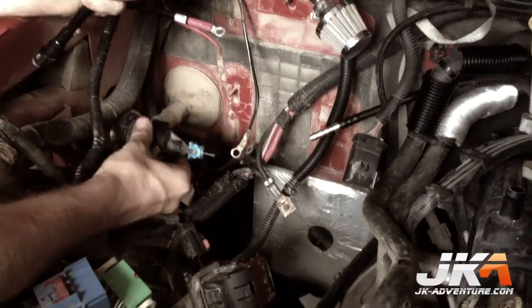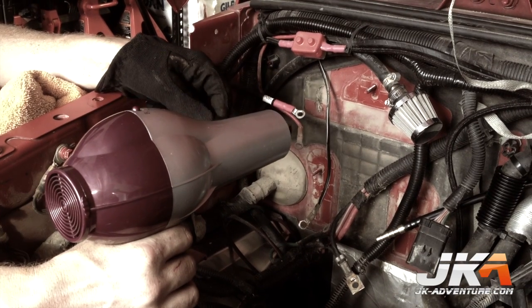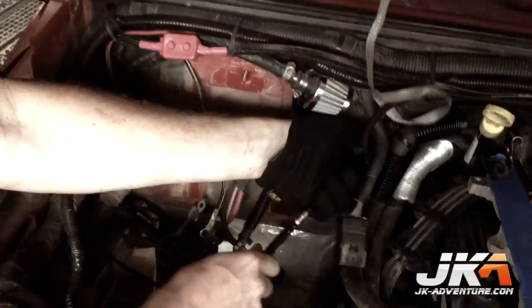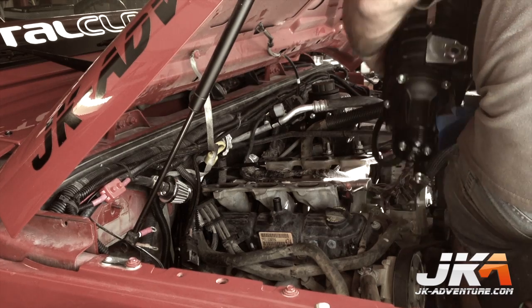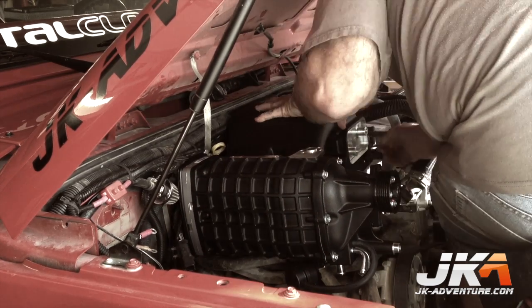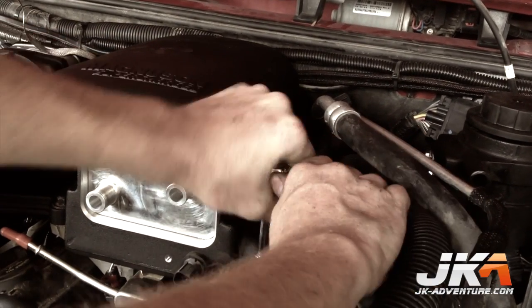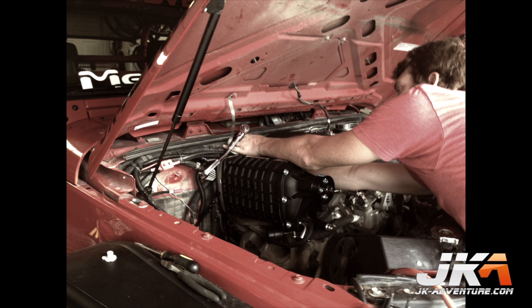Measure and cut the EVAP solenoid tube at this point in the process — after holding the solenoid in its approximate location on the bottom of the new battery box, trim it and install it on the barbed fitting. Now remove the tape protecting the ports and, with the help of a friend, guide the supercharger manifold into position. The fuel line needs to be routed through the cavity between the inlet tubes and the support frame — be careful that the O-rings do not come loose. Reinstall the eight manifold bolts and torque them down in a crisscross pattern in multiple steps. The back two bolts on the passenger side are quite a challenge; having someone with slender hands help will avoid a lot of frustration.